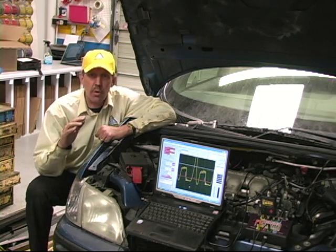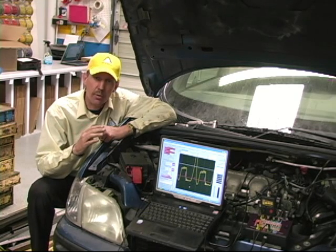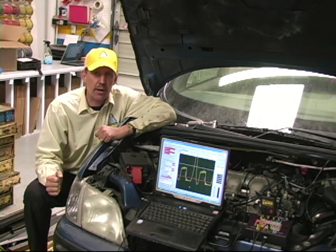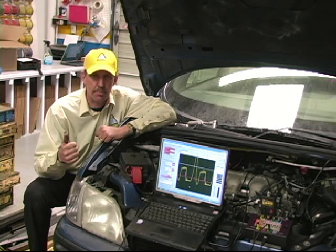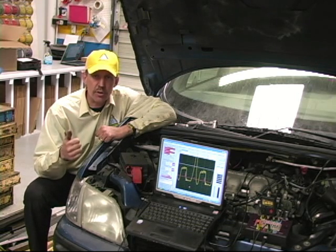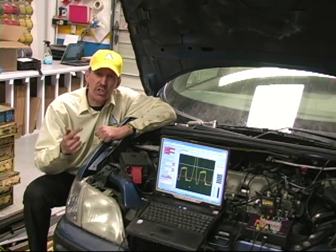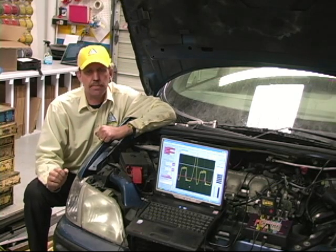If the scan tool would give the technician the correct data from the beginning, that cylinder 1 was missing, not 4, he would have found this misfire quickly. The problem is he had already seen that cylinder 4 had a problem. The intake valve was stuck open, as we've seen. Now that the scan tool still identifies 4, it just gets him confused.